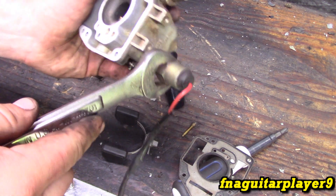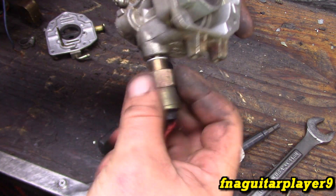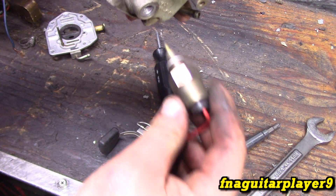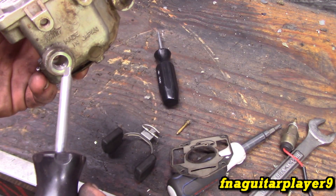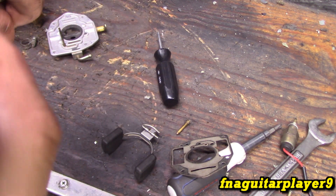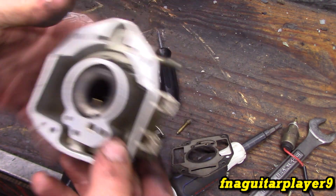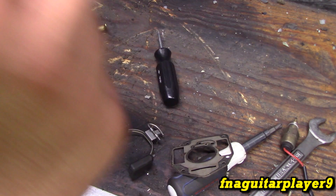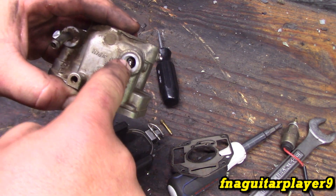Removing the fuel solenoid gains access to the main jet - use a three-quarter inch wrench; it's usually tight. It just screws out like this. If you're replacing the fuel solenoid, just remove your old one, unhook it from the wire, and put your new one back in - you'll have a little washer there to seal it. After you remove the fuel solenoid you can reach in to where the main jet is. If the jet won't come out, it's going to look very similar to this - you just want to clean it out real good and make sure you can see all the way through it.